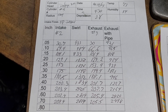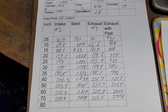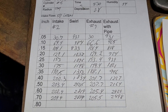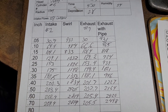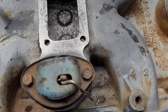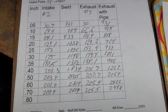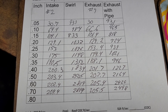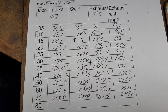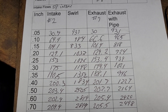The single plane intake started at about 168 CFM, and we're still almost 30 CFM up — that's a big difference. We did number two and number seven, which are both outside ports, the longer ports. Take a look at how close those came — really, really close — and the swirls are really similar. Overall I'm pretty happy with the way they look right now.